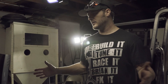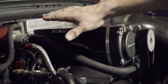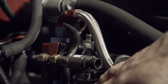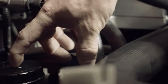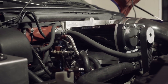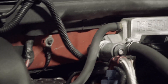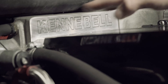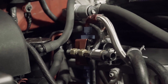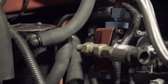So what we've done now is we've gone through everything. Some of the things we were able to do for this owner: we've modified the PCV system. It previously had some janky filtration system that was dumping back into the factory oil cap — it had a hole drilled in it. What we've done now is we've gone to a catch can. This catch can is gonna help him catch anything — he's running on E85 currently, so there's gonna be a lot of moisture and vapor created. When we had taken the blower apart, there was quite a bit of oil accumulation in the inlet and the elbow. Now with a proper vacuum, that should draw enough air to clean out that inlet and elbow quite a bit. It's gonna filter it here in the catch can and dump back into the PCV.